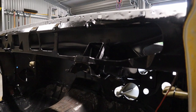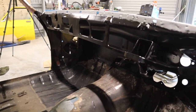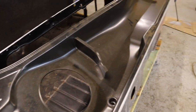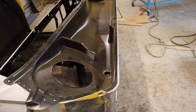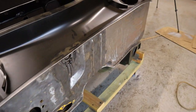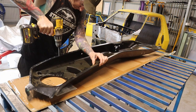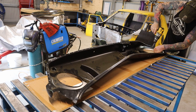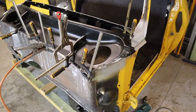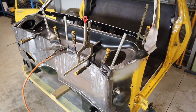Early start this morning - I've had a look at the coating and I'm pretty happy with just the one coat, I don't think it'll need a second. I've put the plenum in and I'll mark and drill all the holes for the spot welds. I don't think it's necessary to put in as many spot welds as the original - I'll go with about a two-inch spacing. With the plenum clamped in there's no tin canning, so hopefully it'll stay like that when I weld it in.